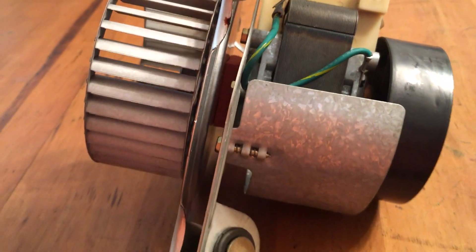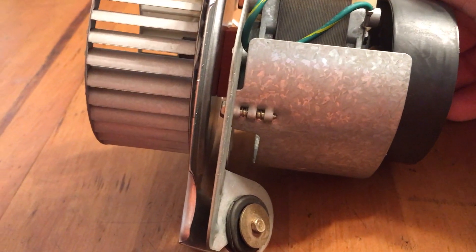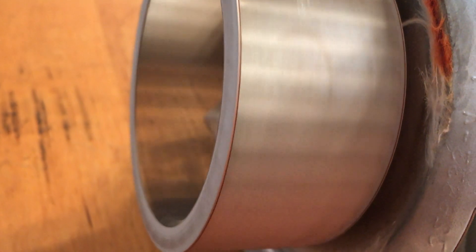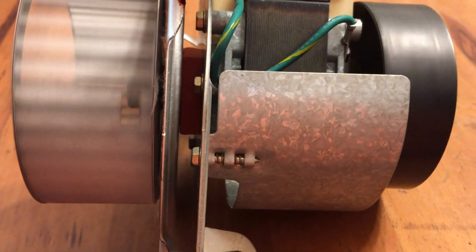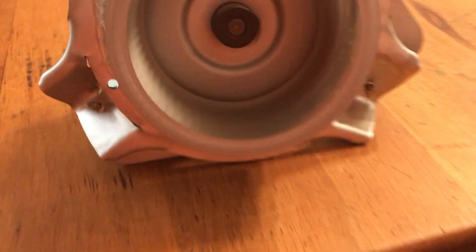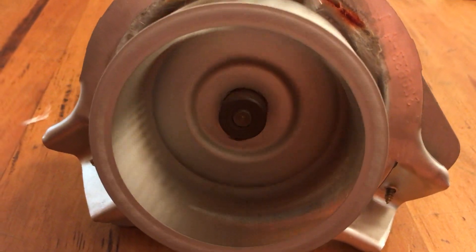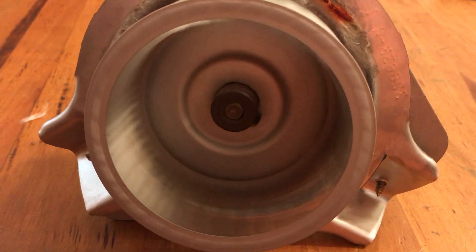Here's a look at the old inducer motor assembly. I'll spin it and you can hear the fault — it wasn't anything to do with the grommets, something with the bearings or motor, something's out of balance. Sounds more like a bearing issue to me — nothing's rubbing. So this has been a look at replacing the inducer motor on the 2003 Carrier furnace. Thank you for watching.